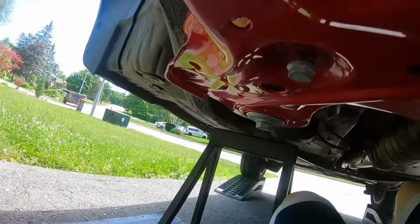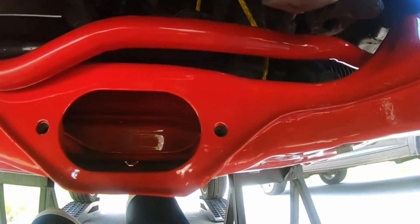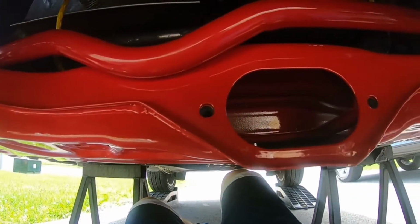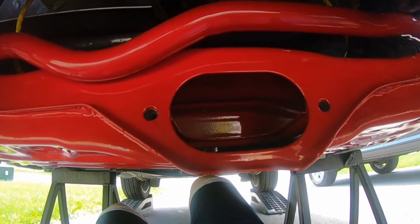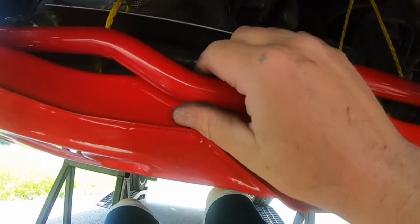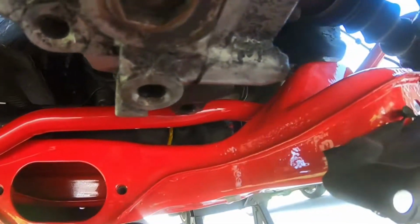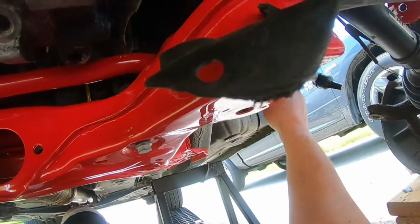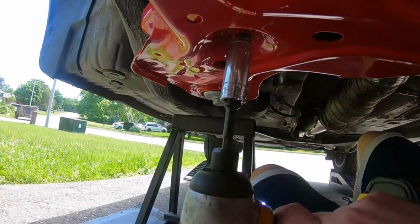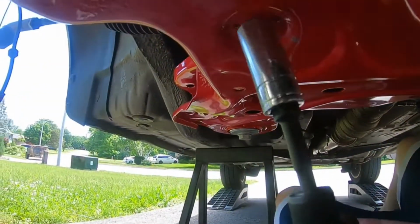And again, guys, just kind of loose fitting everything. Make sure you torque everything at the end when you tie everything in, control arms, the whole 9 yards. Yeah, make sure you do all that when you're done. I'm gonna say it like 1,800 times during this video, as if I don't annoy you guys enough with a bunch of so's and nice dude stuff. So I'm gonna be saying that a lot. Make sure you torque everything. So just tightening up steering rack bolts.